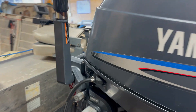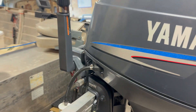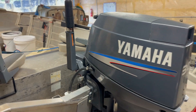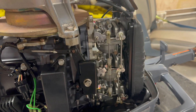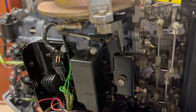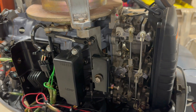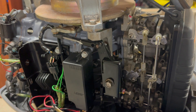This particular engine is a Yamaha 30D-MH. It does not have power trim and tilt, and it does not have electric start. For some familiarisation on how this engine works, we have three very basic carburetors. I'll just put it in gear so you can see the full throttle range. At low throttle, you can see that arm moving — that's actually advancing the timing.